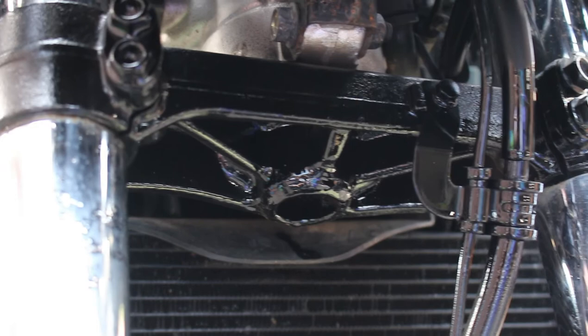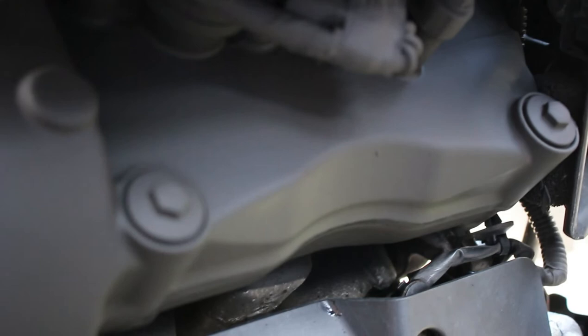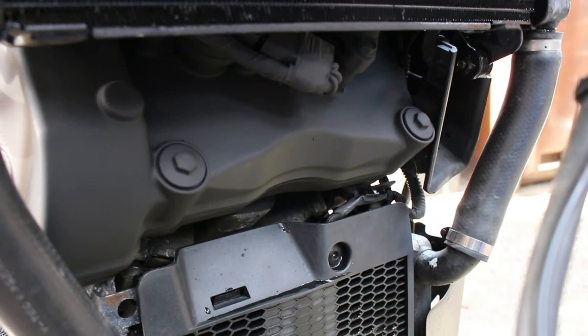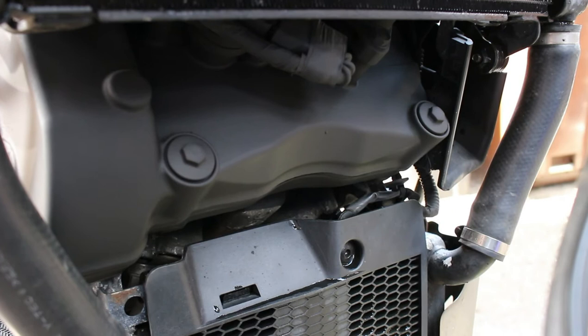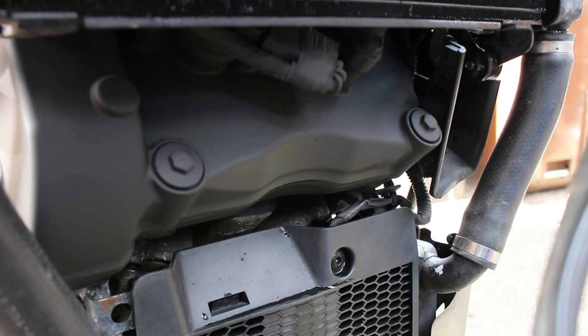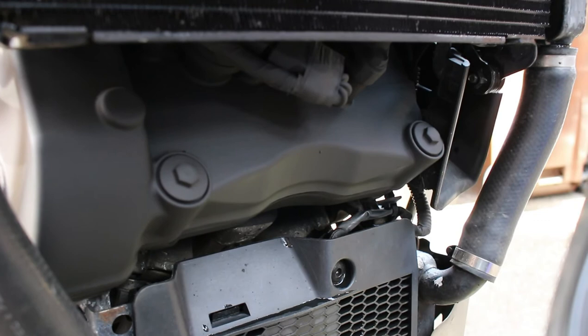There's no longer any rusty looking paintwork on that area - it all looks nice and glossy and black. And that is how our cam cover now looks - really nice, no flaky paint whatsoever. The way this paint cures, it will cure after about 10 hours naturally. You can speed up the process by actually running the engine and allowing it to cure that way, but personally I prefer it to cure naturally, and then once you go out on the bike it will heat up and also help harden and cure the paint.